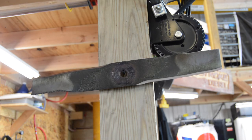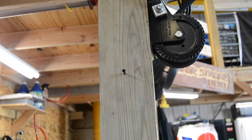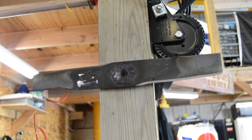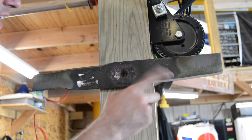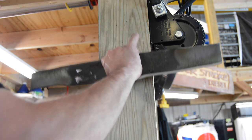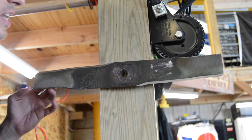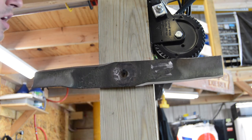That one's pretty darn level. I think I need to take just a little bit more material off this side and we'll see what it does. Alright, so now I just took a little bit of this grass material off — it's just been beaten onto there. You can clean all that stuff up if you want, but there it shows a perfectly balanced blade. You can turn it over and do it with the other side of the blade as well if you don't want to be biased to one side. It's as easy as that. Anytime you have rotating mass, you need to make sure it's balanced or you're going to get a heck of a wobble. I think that's a pretty darn good balanced blade — I didn't have to do much to it. And that's how I balance my blades.